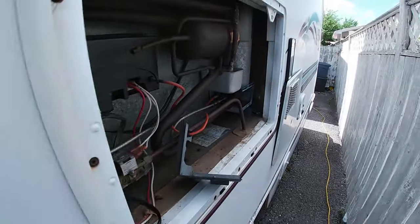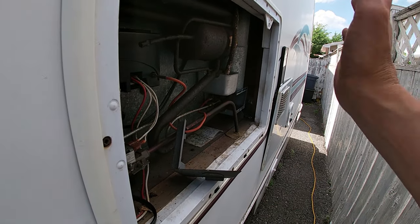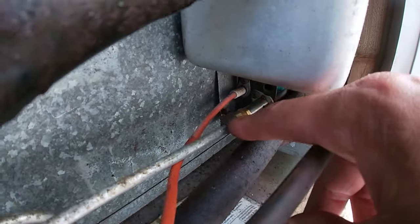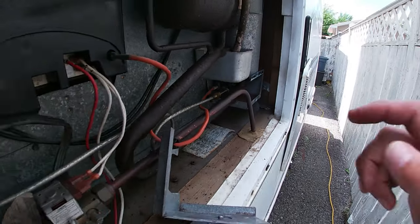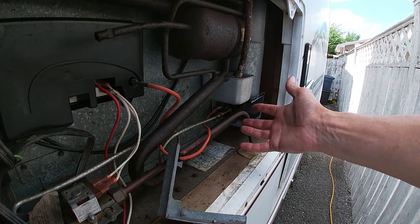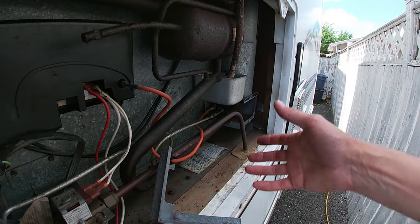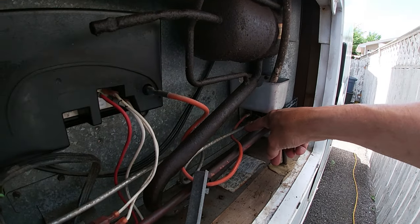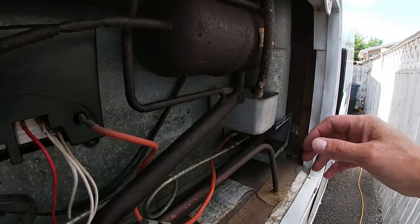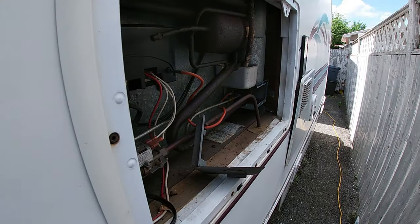That's my next project. I'm going to put the dust cover back on and turn the fridge off and take this down to an HVAC dealer and get that fitting checked — the one I removed. Because you don't want any open propane just sitting in your fridge cabinet; it could very easily ignite when the fridge turns on. If you have propane coming out of here into this cavity, you will blow the back of your RV off. That will literally explode. Raw propane up inside this cavity — you will have a very serious problem on your hands. Go get that checked. That's the entire repair.